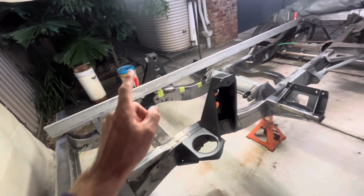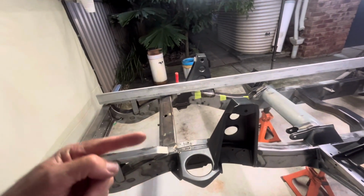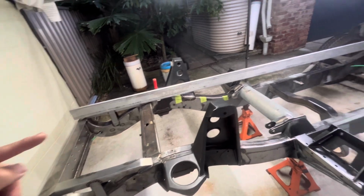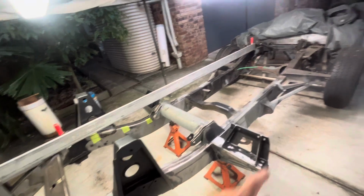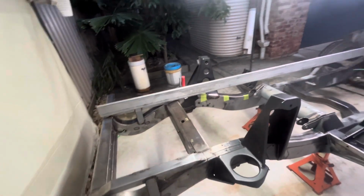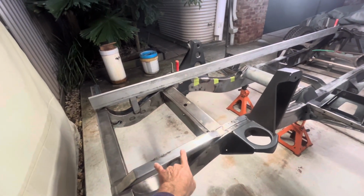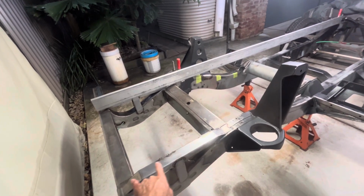And if the rear tub is at the same angle, so is the entire body line, because on the Land Rover bodies where they come up flat and then they curve in, the crease line, if you want to call it, that is one straight line, or it should be. They shouldn't go down and then flatten out and then kick and all this sort of thing. You've got it in the bulkhead, front bulkhead, through the door, rear bulkhead, front of tub, whatever you want to call it, through to the rear. So if the tub load points, which they show, the rear load point that you'll see, that's sort of on a TDI, it's different to a TD5, but they are both parallel.